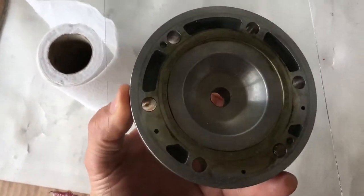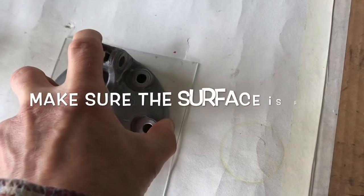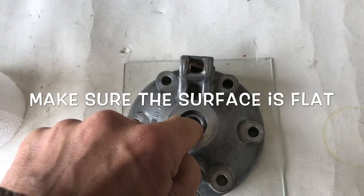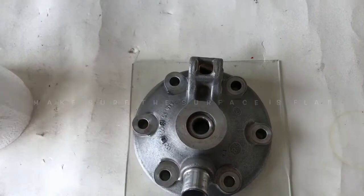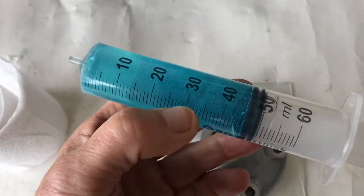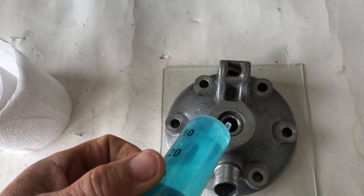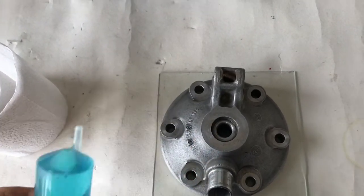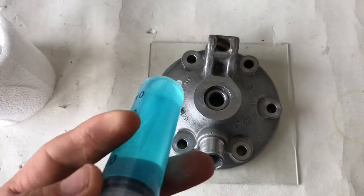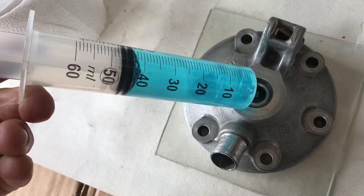Take your cylinder head and just turn it completely over and lay it flat like that. So now what we're going to do is fill up in here with our liquid. Remember we haven't moved the syringe since when we filled up the spark plug, so we're going to continue filling from where we left off. I'll give it my best shot — it's a bit difficult to hold this with one hand and do it.